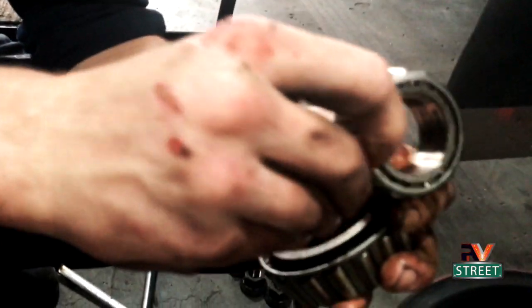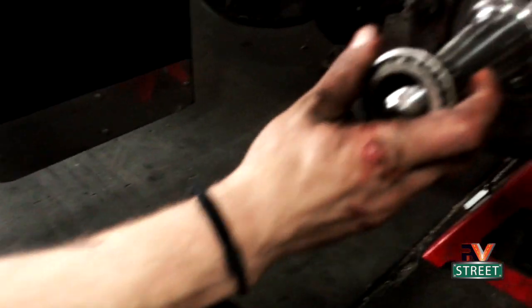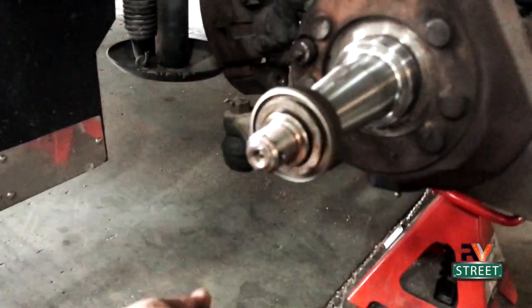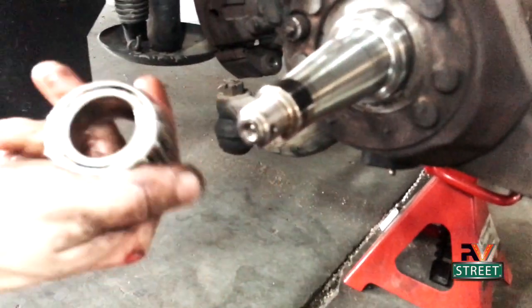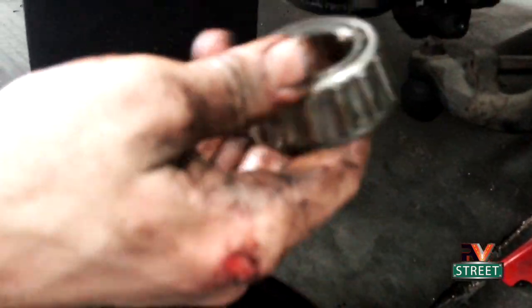In his words: basically you have wear on the inside of this bearing - this is supposed to stay in place over this so whenever you have it torqued down it should stay tight. This should stay in place and only the spindle should turn, but this one was not quite torqued and so both were turning. With them both turning it burned up the inside edge like that. But once we get it torqued back tight that'll be okay because the outer cage of the bearing is fine and there's no pitting or anything.